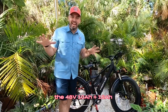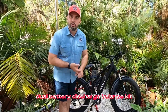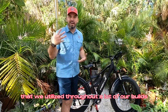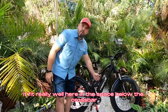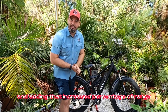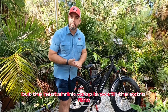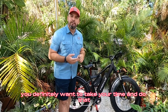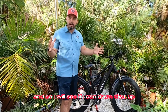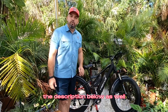We are back in action. The 48-volt, 26 amp hour Troxus Volcanus build is finished. We did it with a 40-amp dual battery discharge balance kit and the typical 48-volt 10 amp hour battery we utilize throughout a lot of our builds — it's just so versatile. It fit really well in the space below the crossbar, and we look forward to testing it and adding that increased range percentage with this second battery. The heat shrink wrap is worth the extra time. I've also seen a guard plate that people are putting underneath — I believe it was in the Troxus Facebook group, so I'll check that out and put a link in the description.